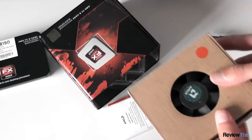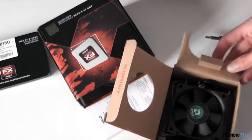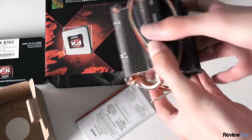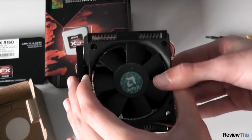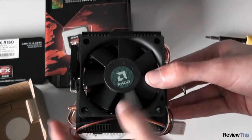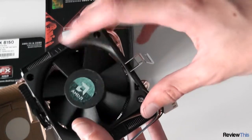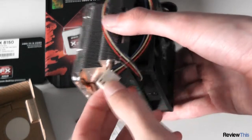First of all we get the AMD stock cooler. This is the same sort of cooler design as you'll see from years ago. In fact, you can use AMD coolers from the last few years and they'll still all work on this latest processor — AM2, AM2+, AM3 — they'll all work as long as they can carry the thermal output of this processor. This is actually quite a nice cooler. You've got a fairly small fan, however lots of fins and four nice big heat pipes. And also you can see we've got a PWM fan, so that will allow it to be nice and quiet.